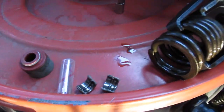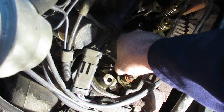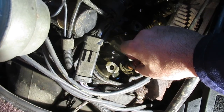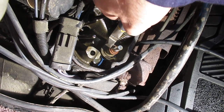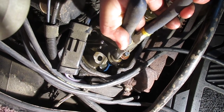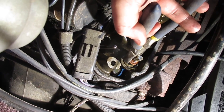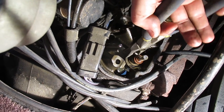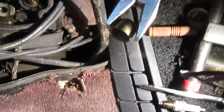Got the keepers out — it was pretty easy. You get one out then push the valve sideways to get the other one out. I checked that this tube here is the right size for the valve stem and it seems to be the right length as well. You can see on this one here it's not pushed down all the way — not sure if it was supposed to or not. See how easy it was to take that off. I'm almost certain that on the next cylinder we'll find that the other one was bottomed out. I think this exhaust valve was always improperly sealed.